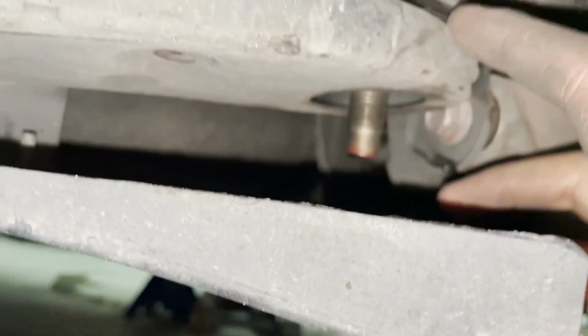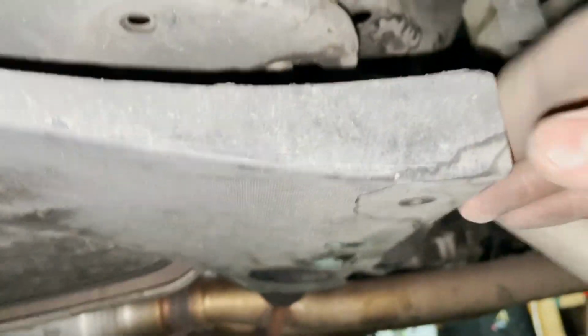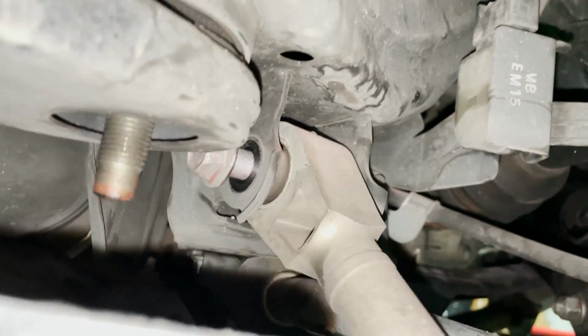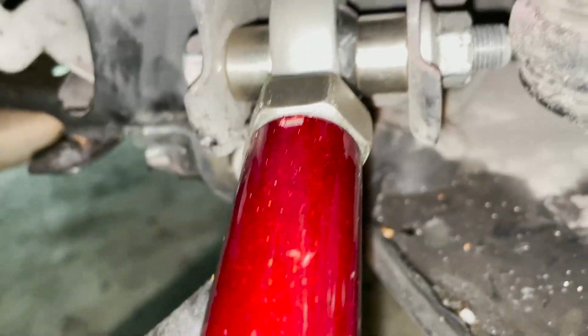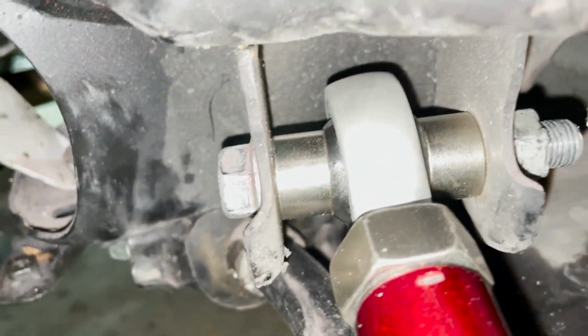All right, so for the traction arm, I forgot to mention on the other side, the bolt in there actually will not come out because of the subframe, this little piece here. You have to take it out to get the bolt out. It hits under there, so you need to take off this little splash shield. It's just 10 millimeters, and then loosen up the 2 bolts in here. You loosen up these 2, and then you drop this down quite a bit for you to pull that out. What I did on the other side is actually reverse it, so in case I ever need to mess with these again, I don't need to drop this. On this side, after dropping it, as you can see, I have the nut on the right side closer to the little subframe mounting point, and the bolt that way. So the bolt's going to slide out to the left, so I can get it done faster if I ever need to squeeze back in there.